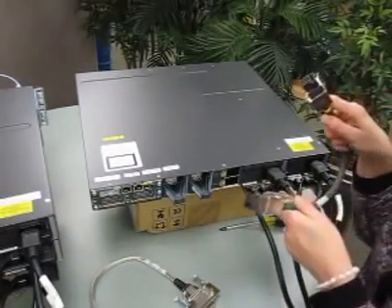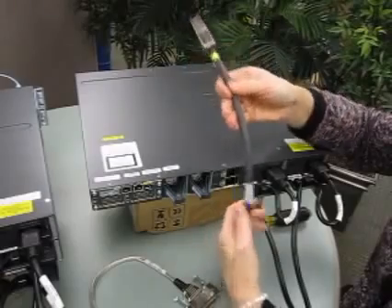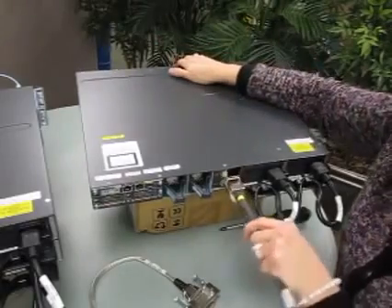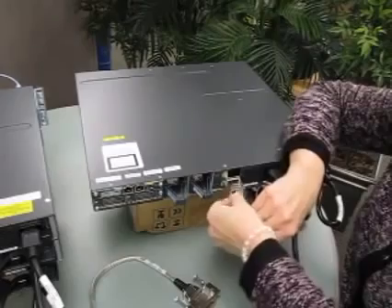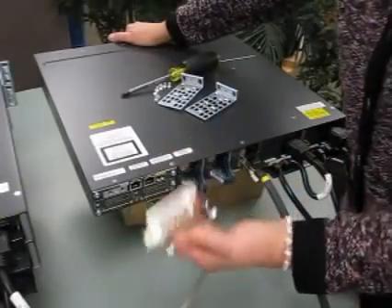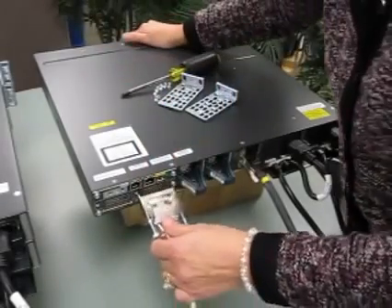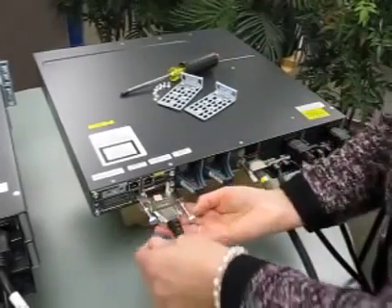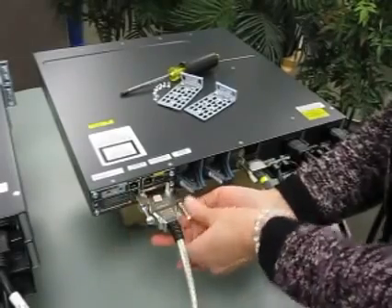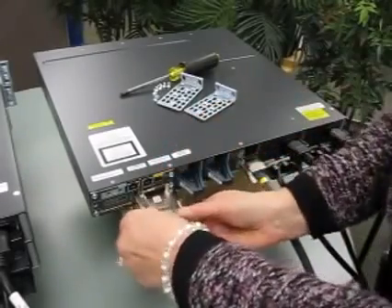Our next step is the actual power stack cables. There is no difference between the ends, but if you look there is a color code — one side is yellow and one side is green. You have to make sure that you match yellow to green and green to yellow. That's how the stack works. So we plug that in and screw them in place. The next cable to install is the actual switch stacking cable itself. If you look at it closely, it actually matches the picture on the back of the switch — the shape of the interface. Get that pushed into place and screw those in. Hold it steady because it's difficult if it's not straight on. Do a little bit on both sides at a time and they'll go in nice and square. Start with port 2.